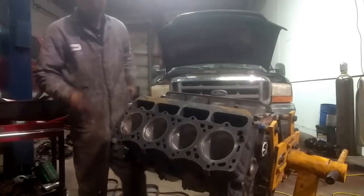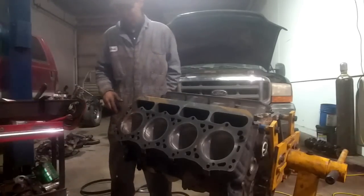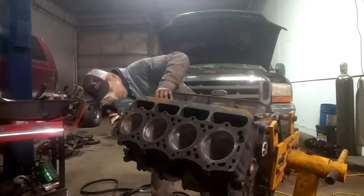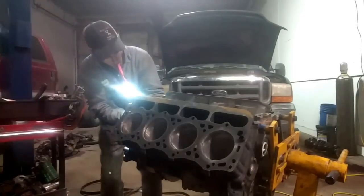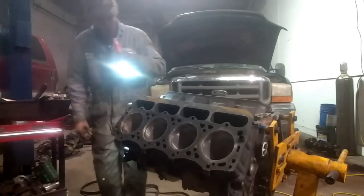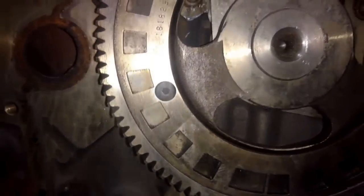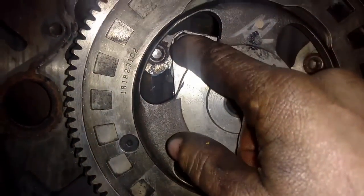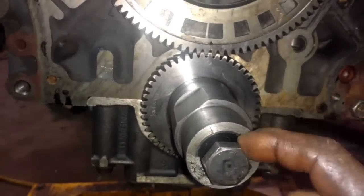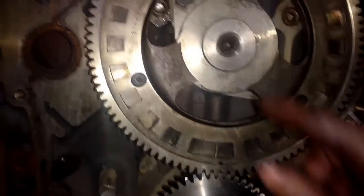Once you get your gear started — that's a beveled, tapered gear, not a straight-cut gear — grab your mallet and just tap it in. There are two bolts on the thrust plate. We've got our timing marks lined up, cam and crank are installed. Rotate the crank a little bit to access the second thrust plate bolt, but start the first one first. These thrust plate bolts are 18 foot-pounds.